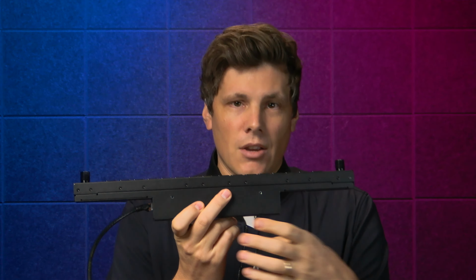And for me, this is the really novel thing here, because USB used to really limit us to a local computer. But now you don't actually need a local computer workstation, and you can connect via a single cable with power and control all the way back to a central server. So it means you can centralize your management, which is going to have easier security, administration, and updates. And it also means you can do very long distances. Rather than USB being about 6 to 15 feet before it becomes unreliable, Ethernet can run for hundreds of feet, and it's going to be really great for bigger installations.